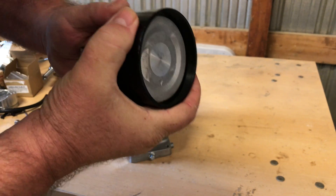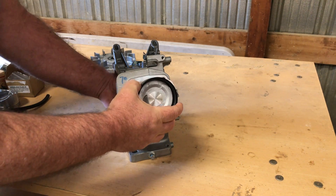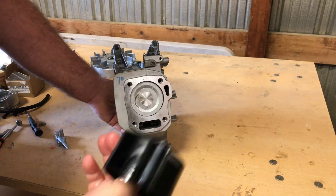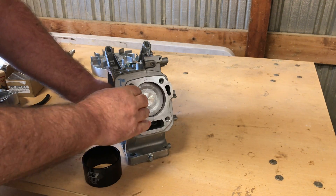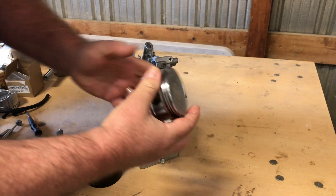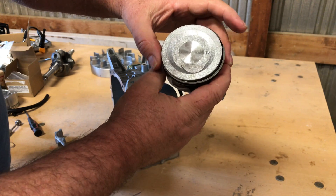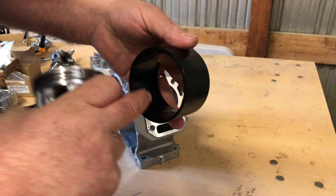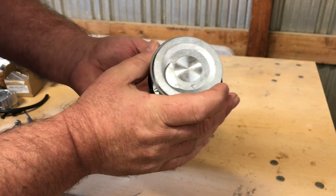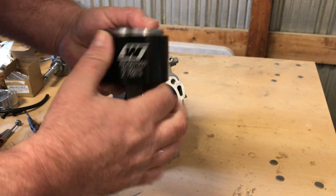You start in the big end of the taper and leave a little skirt hanging out of the piston so you can start it in the bore, then just give her a push down — and that's it. These cost around 30 bucks. A lot of guys are probably thinking there were no rings on that, but yeah, these are the standard rings. These are not low tension rings — these are stock tension rings and they've got quite a bit of tension on them.